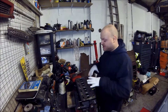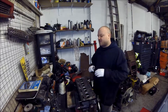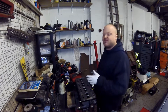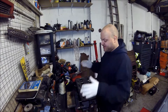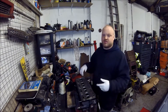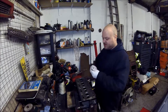I'm going to show you some of the tools I used to bring this cylinder head back to life. The first thing was the guides — there was a bit of corrosion and some scoring, so we had to hone them back out. On an aluminium head you have options: you can have your valve guides pressed out and new ones fitted. But this is a cast iron head, so the guides are actually part of the cylinder head. You can't remove them — the only option is to drill them out and press new guides in, which is a lot of work.